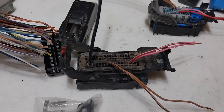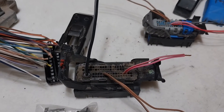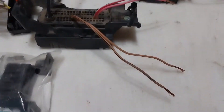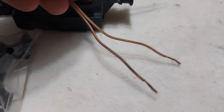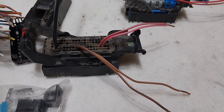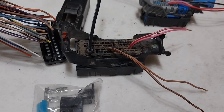You only have one ground wire and that's pin number 73. Two power wires — that's number 19 and 20. But then there's two wires for the data signal and it runs off a CAN bus, so you have a positive and negative. Those are number 27 and 28 on the ECM.